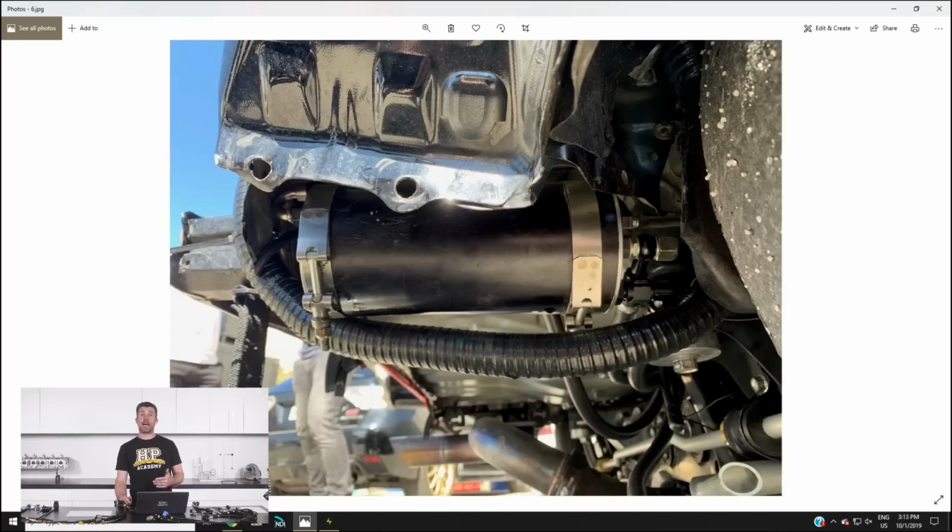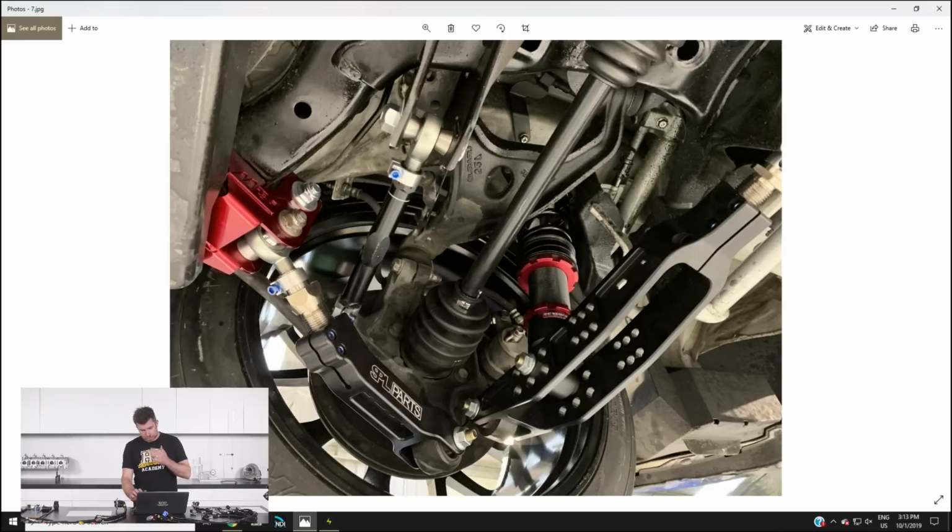So this is fed power via an ECU Master PMU, and this is one of those mixed blessings because the PMU is set to fuse every circuit, and we can control the fusing current as well as how many times the unit will retry a particular circuit if it does blow that fuse. What was happening here is it was set to basically indefinitely retry the fuel pump circuit. It would blow that fuse, wait 1 second before reinstating power. So this is what was causing our fuel surge. Ultimately we're going to get on top of that anyway, and we'll be ready for this round of the championship.